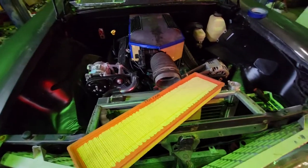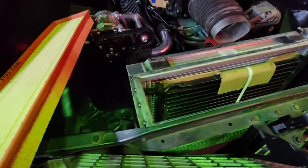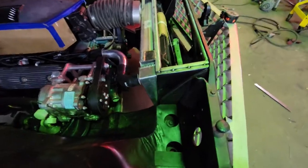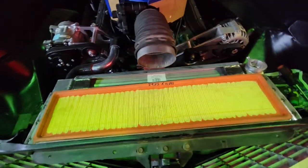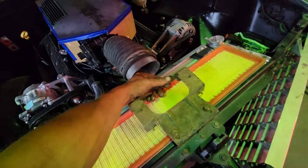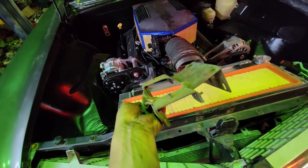Should have enough surface area to feed this six liter. Got my receiving groove made for it, got some small three-quarter inch formed angle, and I've got the sides of the radiator sealed off so all the air that comes in the front of the car is going either through the air filter or the radiator. That's fitting in there nice. Got my height gauge, which is the old radiator mount — I've got quite a bit of room there to work with, so that'll work out. The radiator cap on these cars sits up a little bit higher, so I've got more than what's there.